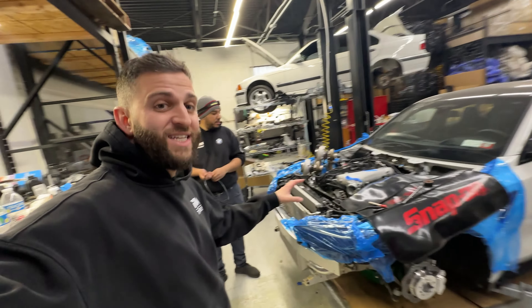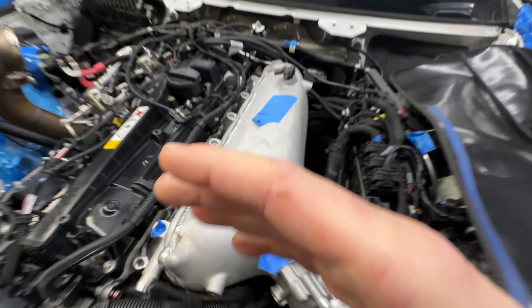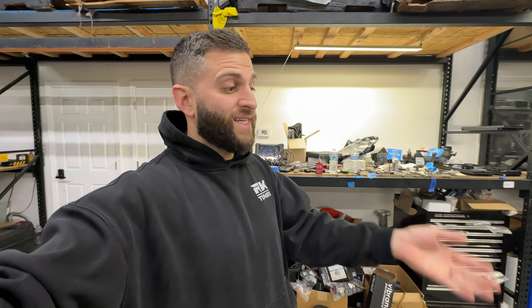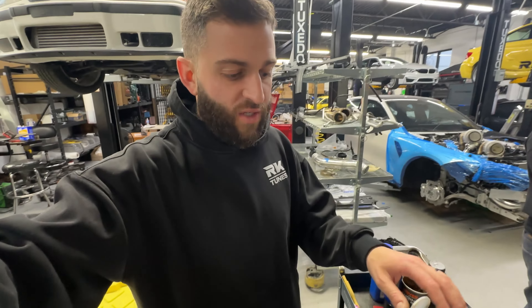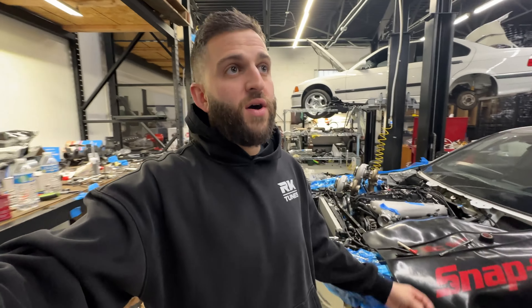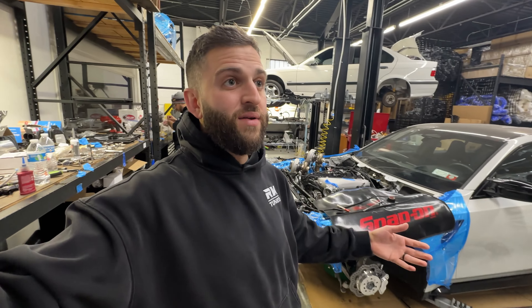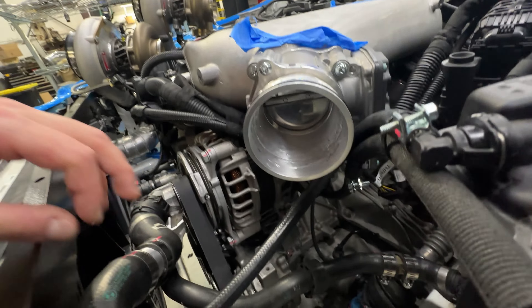The car is getting buttoned up — this is the final stretch. The intake manifold is fully on. We ended up welding the intake manifold together because I don't like the idea of just having bolts — over time they can break or leak. It's fully bolted still, but we removed the O-ring from the inside and welded it. Wagner thinks it's a great design that'll last forever. I got a spare from them. My plan is to plate this so there are no gaps going around and make it flat — I think it's going to help with power. Under a ton of boost, I don't think velocity stacks are needed; I think it takes the path of least resistance. It may just cause a little turbulence, or under pressure it does nothing, but I don't think it's really needed or beneficial.